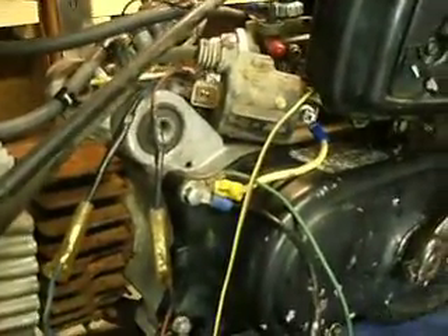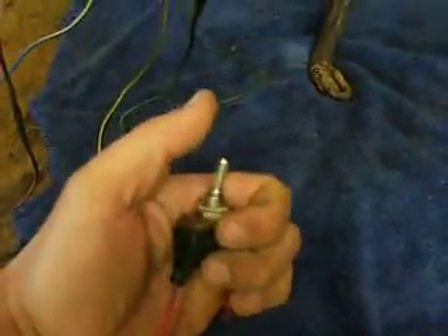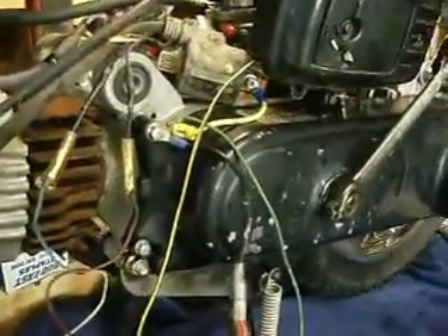And that's all you need as far as the wiring goes to run an express or an urban express. They both work the same way. The switch simply is to stop the engine — it grounds out the coil and stops the engine.